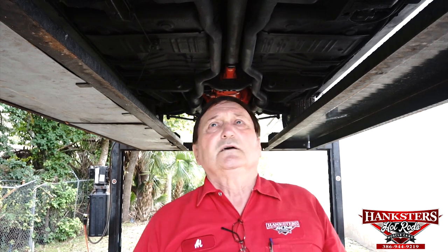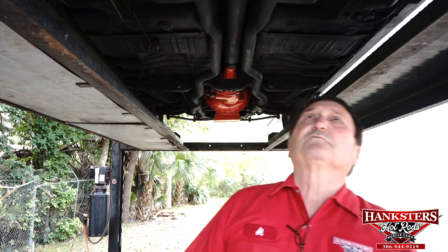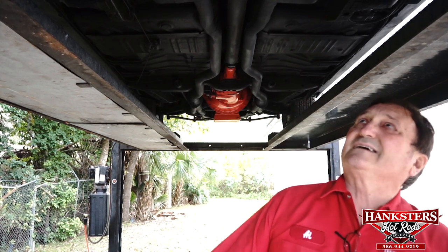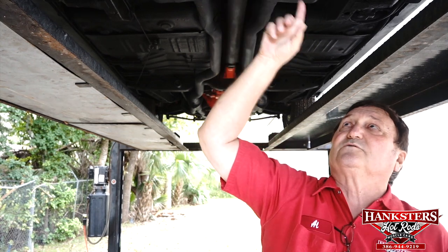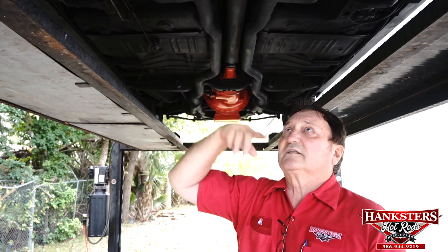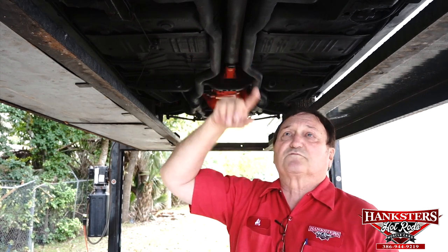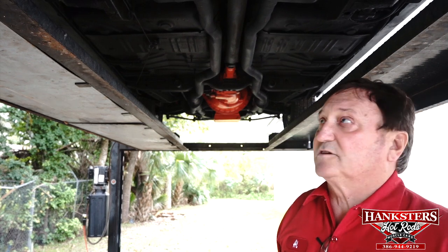The correct exhaust tips are on the pipes going out the back. It does have the original gas tank in it yet also. And the big guy here, Dana 60 carrier, totally indestructible. There's not a motor out there that'll break that rear end. It's even stronger than a 9-inch Ford. This is a 9 3/4-inch ring gear. Really heavy duty. 3/4-ton Dodge truck material.